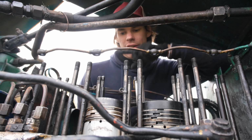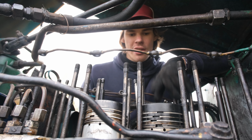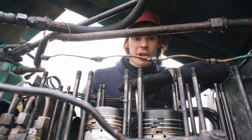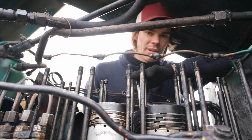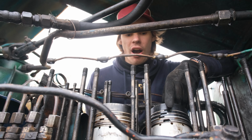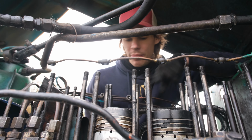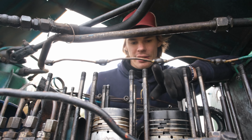Everything off, we are fully bare bones kind of, so we have all the pistons visible, and there is quite a lot of rust. That's from the condensation in the winter. That wouldn't be much of a problem, but the rings are all in the same line. I clearly didn't know. Some of them are perfectly apart, and this one is the worst one.